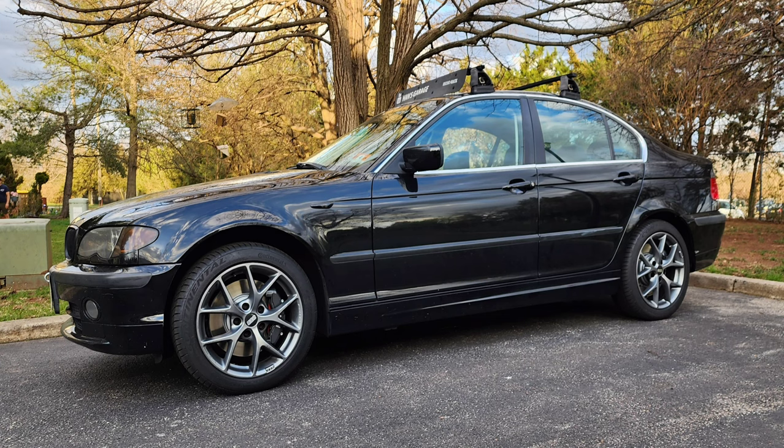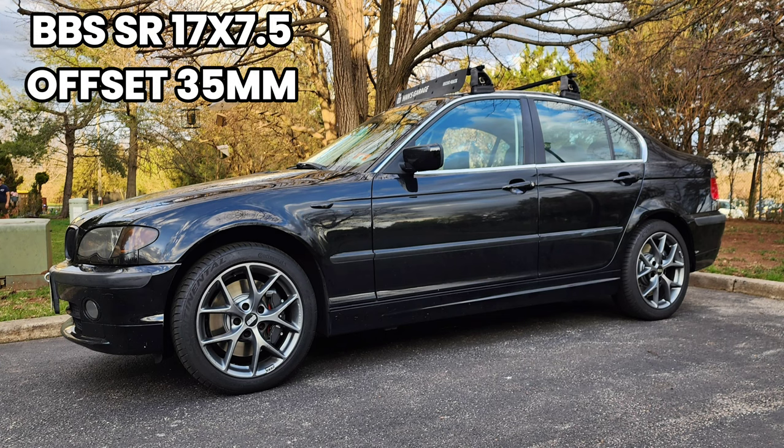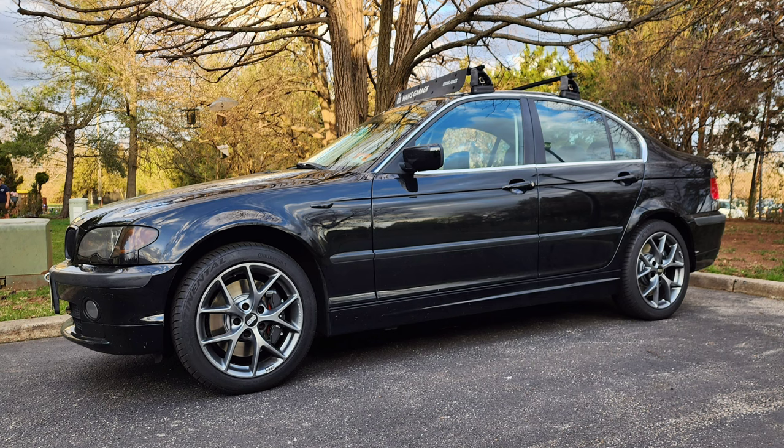Finally, as for wheel fitment, I've got BBS SR wheels, 17 by 7.5 with a 35 millimeter offset, and they fit perfectly without spacers. I hope this video was helpful for deciding whether you want to do this conversion or not.